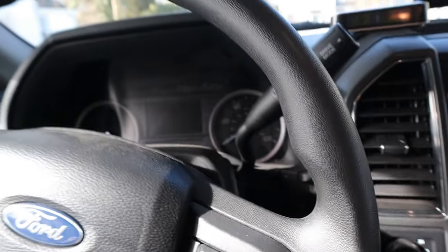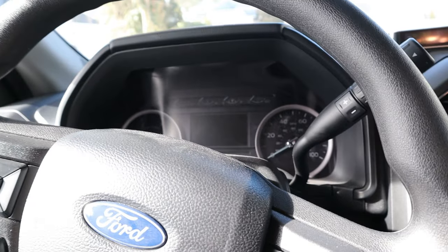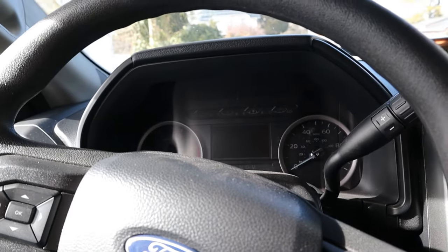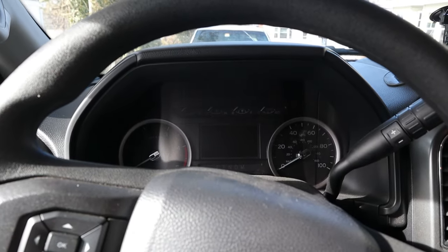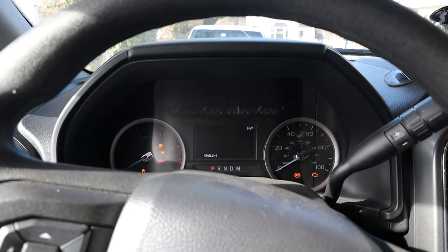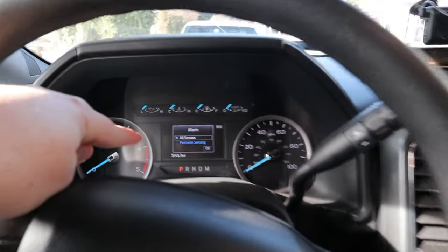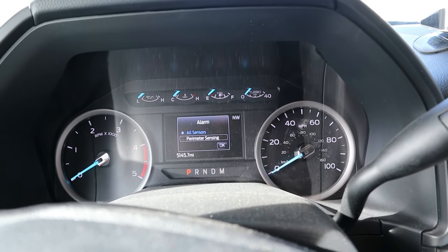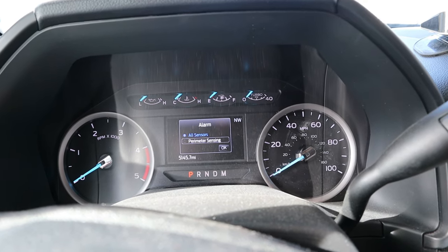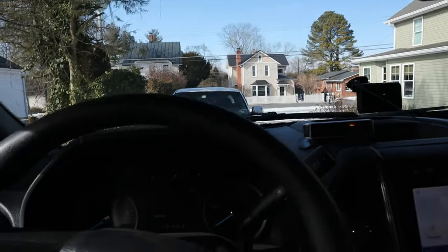Let's focus a little on the security system. You have outside sensors — they'll go off if someone hits the RV — but you also have internal sensors, and a lot of folks are confused about those. I had to go into settings to set it up. When you leave the RV, under Alarm you can choose All Sensors or Perimeter. We switch it to Perimeter because the internal sensors are motion detectors and will go off, especially if you have animals.